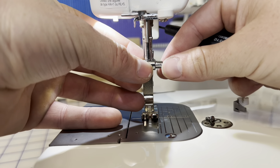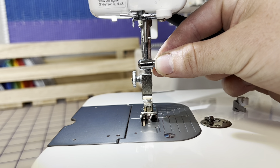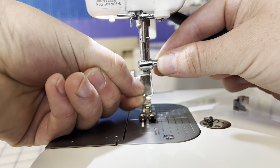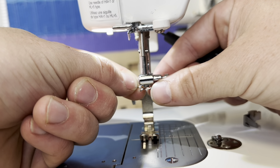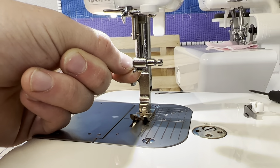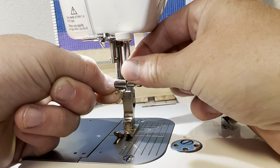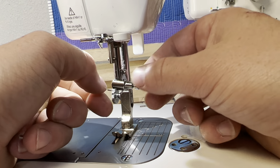Take that out and then this thread guide just comes completely straight down like that — that's how you're going to replace it. If that were to break, you're just going to hold this needle clamp assembly on there so it doesn't all fall apart. If you want to put this back on, pull it to the right a little bit, make sure this little hook is facing up, put it on the right side, push it up so it's right there by the screw hole. Sorry for the shaky camera — screw fell in a weird spot. Then you're just going to put the screw back in there and tighten it all the way. That's how you replace your thread guide assembly.